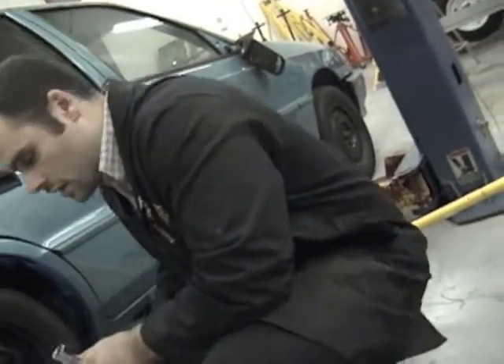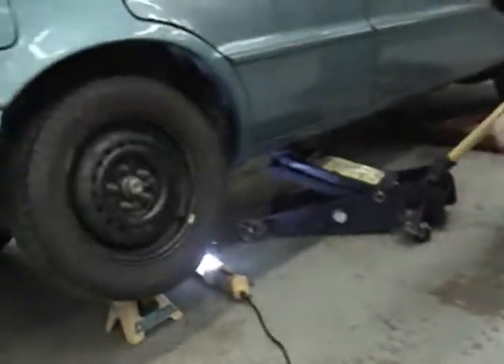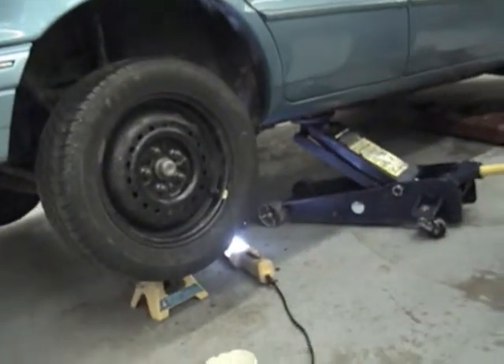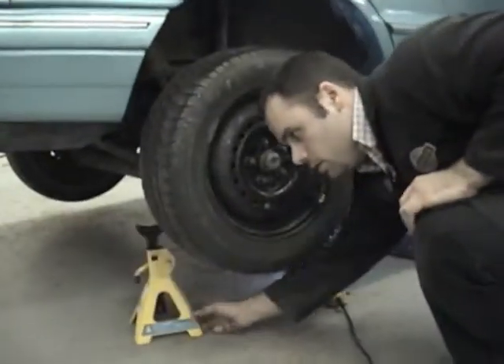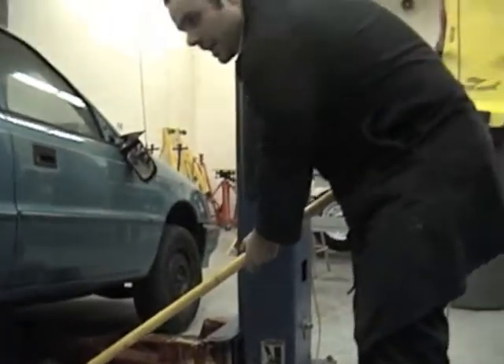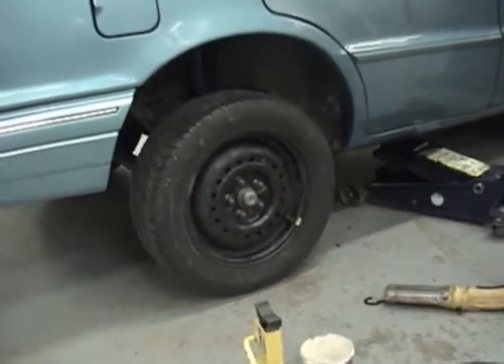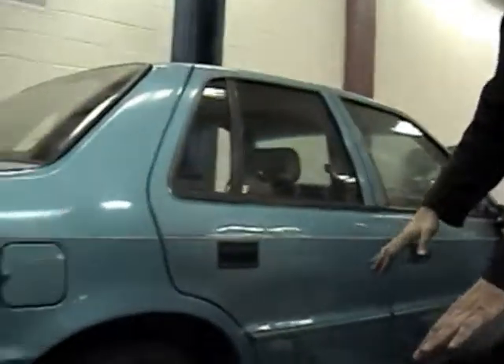Now I've got to place the hydraulic floor jack back under the car and call my instructor over — follow these safety procedures. Do not assume you can forge ahead without confirmation. Once the instructor has okayed the spot, jack the car up high enough to pull the safety stand out, then lower the vehicle slowly by loosening the handle. I don't want the car to bounce. Those wheel nuts are only snug at this point, so we still have to tighten them up.